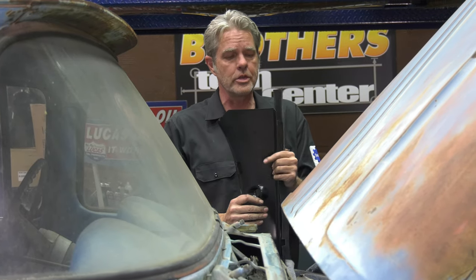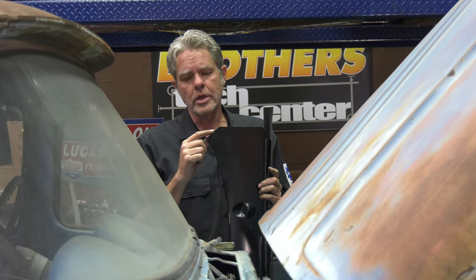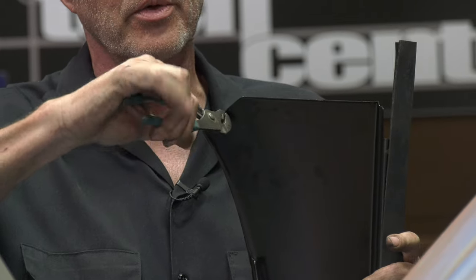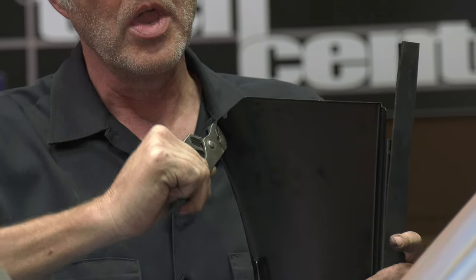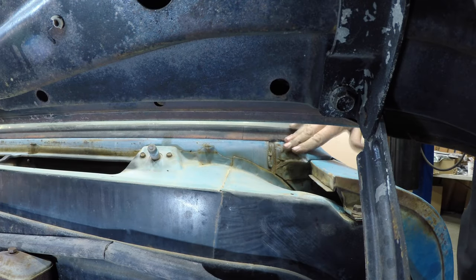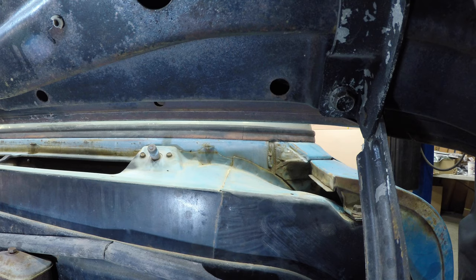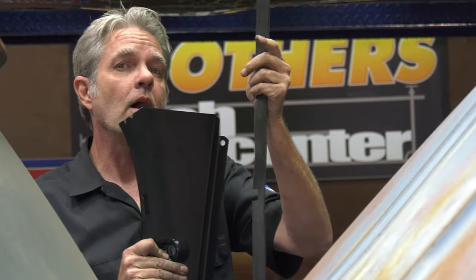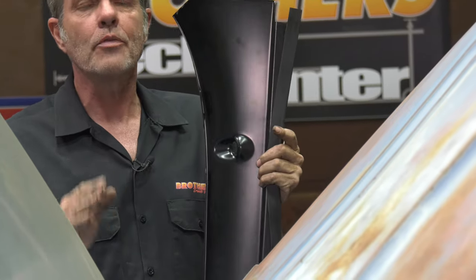Now I want you to know a couple of things about this right here. First, you see these little tabs? Those tabs will come sticking straight out. What you want to do is just bend them down a little bit — not a lot, just a little bit. What these do is on the end right here where your metal comes around, that's where these tabs rest. So when I put it on, it'll be up a little bit high and I can just push it down and that'll bend these tabs into the right spot to give it a nice and level fit. Also, take your rubber hood cowl out of the plastic as soon as you get it and lay it out in the sun with something heavy on it so it's nice and flat and easy to work with.